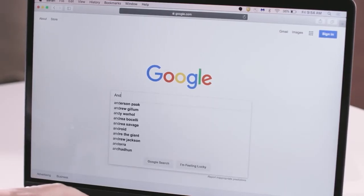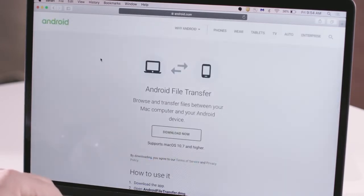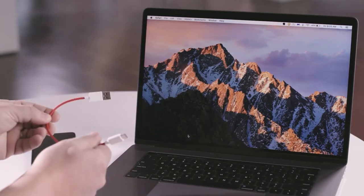First, you'll need to download Android File Transfer to your Mac from Google. You can search for it from your browser or click the link in the description. Once Android File Transfer is downloaded, grab the USB cable that goes with your phone. You'll need this to move the content off your phone to your computer.